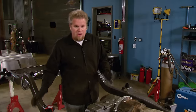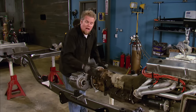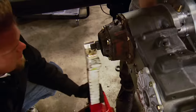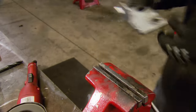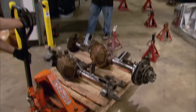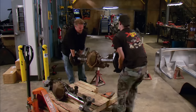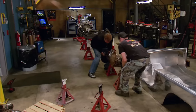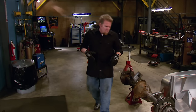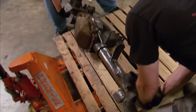One of the cool things about Jeeps is that the transmission mount is integrated into the skid plate. All we have to do is mount it underneath the frame, mark and drill the locations for the rear mount. We'll also add a second mount off the back of the 205 to help take up some of the weight from this extra heavy-duty case. If you remember last time, we built two pretty killer axles for this truck — cut up two 14-bolts, narrowed one, and turned one into a steering axle. We only had a 110-volt welder in the shop to tack on this TJ link mount kit from Rusty's Off-Road, so we carried them to a welding shop and had them fully welded. And now they're back here to have all the lockers, gears, and shafts installed.